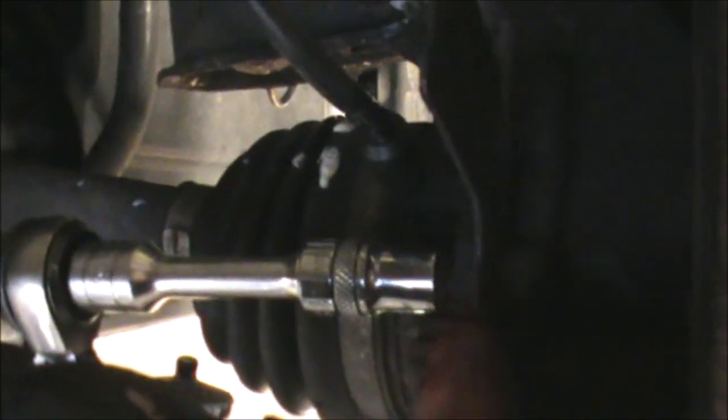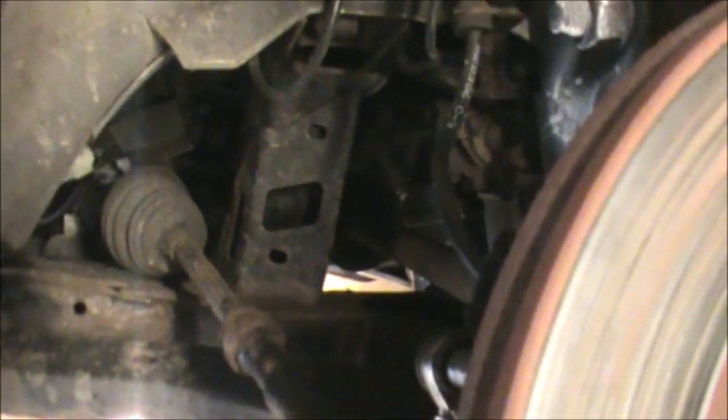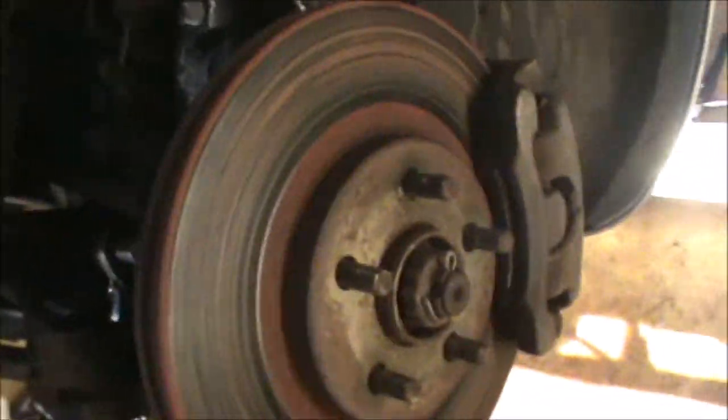and the sensor we're looking for is this one here, which is just sitting there, and it basically reads on this ring here. That's how it measures the speed. So checking with the computer, you could see the four wheel speed sensors, and this particular one wasn't working, and also it was showing the fault code for this side, but obviously just to make sure the sensor was faulty, I checked it with the OBD.